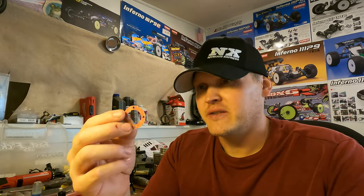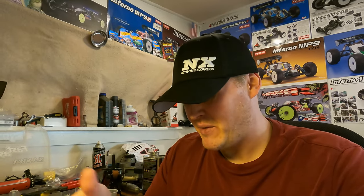The reason behind doing this — my theory — is just giving you a flatter surface to seal to. If you've ever had your differentials leaking, it absolutely drives me crazy. You can use a little bit of RTV on there, but it makes a mess and a headache next time you want to service the differential. It also helps the case sit flush against your gears. It's a little bit of effort but it's worth it — it makes it look a lot better and gives you a much cleaner surface.